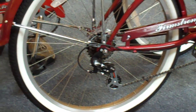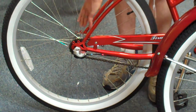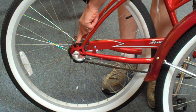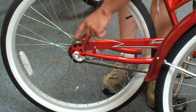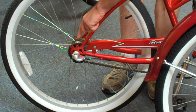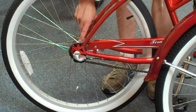Let's move over to the internal gears and see what this is. This is a much cleaner looking system — it actually looks like a single speed because there's only one cog in the back here, so the chain is always right here; it doesn't move anywhere. It's a little stabler in that sense. There's a small shifting mechanism right here that pushes a pin inside and out of the rear axle, which actually activates mechanisms inside of this hub where all the gears are situated.